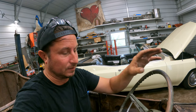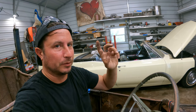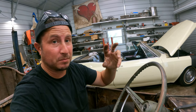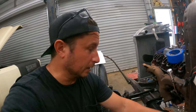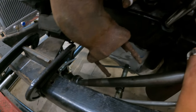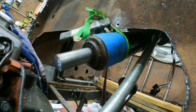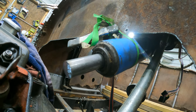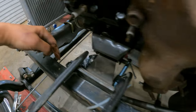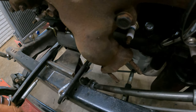In fact, I'm pretty convinced at this point, if I draw out my little thing, that I will be able to prove that it's the same U-joints no matter what. And I can buy some parts and pieces and we can continue the mock-up that way. I need like 3 hands, but if I came off the steering box with a universal joint that's splined to whatever shaft I use, whether it's 3/4 or double D, I'm holding a joint right there. And then if we cruised up and met the steering column somewhere back there, like 5 more inches in, our angles all kind of work better. And to stay out of the exhaust, I think if I lose these spacers and pull the steering box in 1/2 inch, that will make a massive difference.